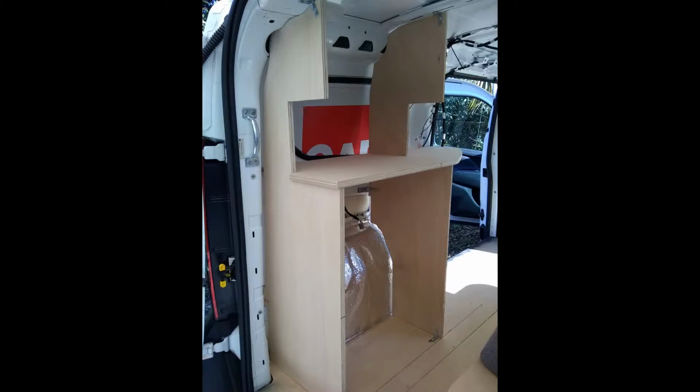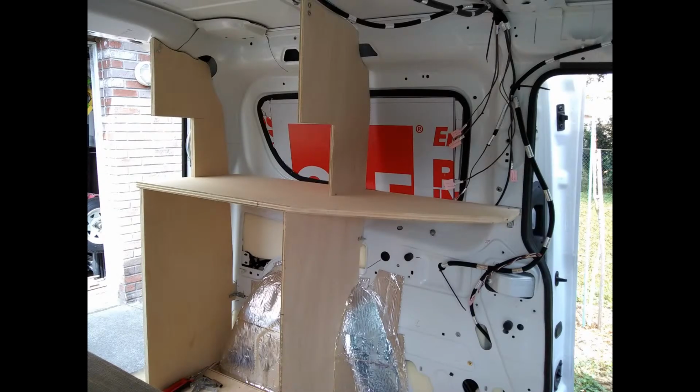Mounting these in place in the van, I then cut out the countertop, which was notched for the right upright support, so it wrapped around it and let me use a single piece that went all the way forward to the side door. The spacing on the verticals was about 21.5 inches, and so to the right of that I just kind of cut a general curve back towards the wall to where it was only a few inches overhang by the time it got near the side door.